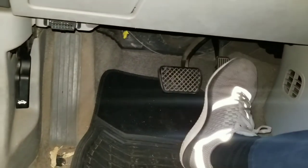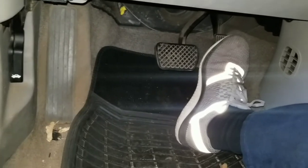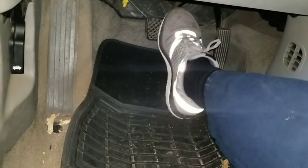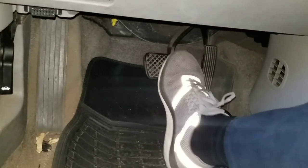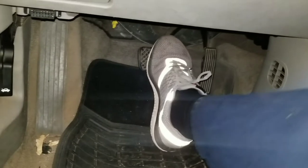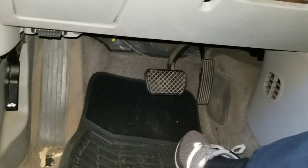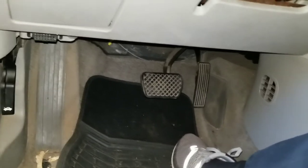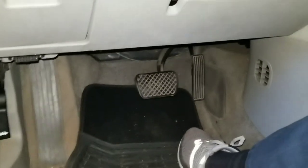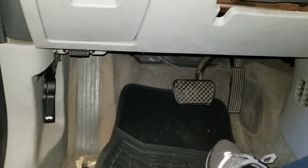See, it's a little firm. So that's kind of an indication that the brake booster is actually holding vacuum. There are other checks you could do to verify that, but that's just a quick check.